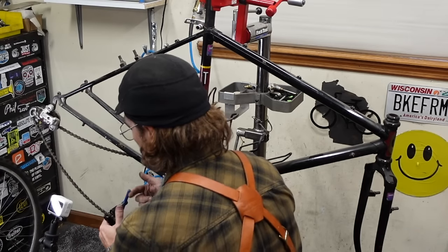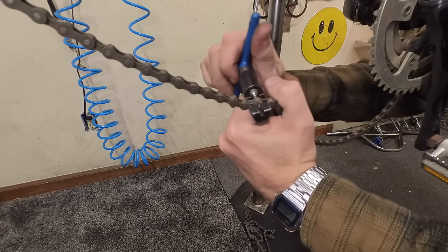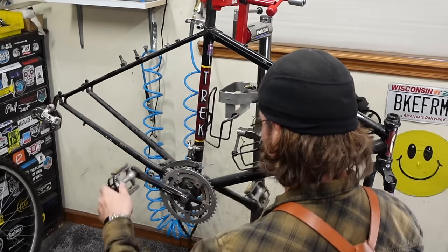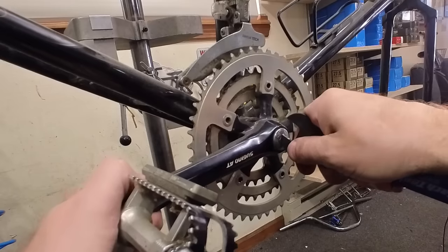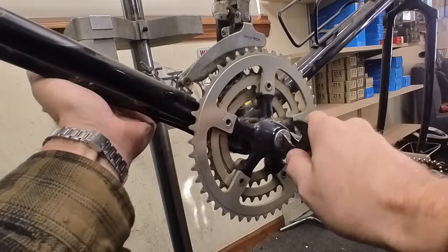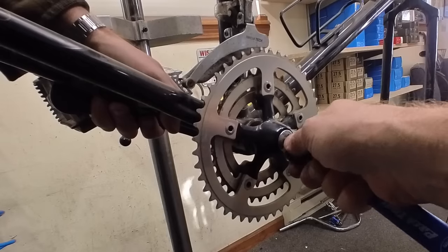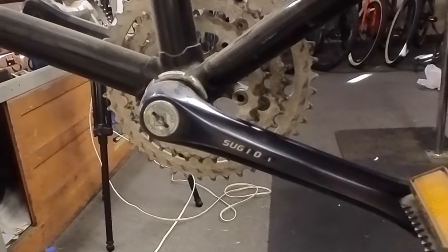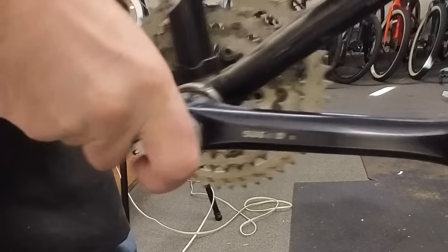So the chain needs to come off. Now I'm pushing the pin out from this side. I always push the pins out towards the outside of the bike because it makes it easier to install. Put that in the rusty bucket. I try to preserve them — they like to break. I have other ones in the drawer if need be. Doesn't want to come out. Try a little bit of Kroil. If it breaks in there, it can be really hard to get a wrench on the bolt. There we go. Much cleaner.